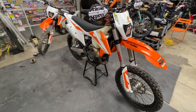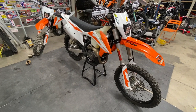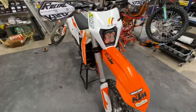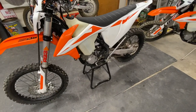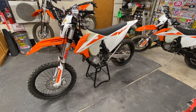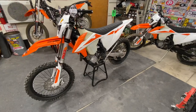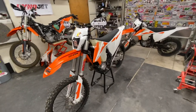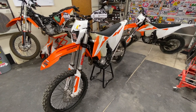I have no idea why they did not put the sixth gear inside that engine, because when you get it as the 500 or 501 it has the sixth gear. It's only on the XCF that the sixth gear is missing. You can convert it, but you have to pull the engine and split the cases. Parts are not expensive — probably $250 in parts — but it's a huge labor expense. Very doable but at a cost. That's a window into what's going on with these 450 XCFs. Like and subscribe, let us know in the comments if you have any thoughts about these bikes, and as always, go out and get some adventure.